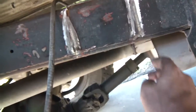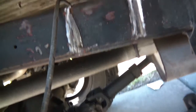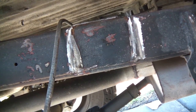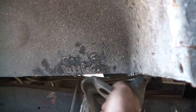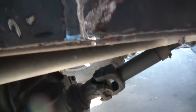Hopefully I didn't cut too much into the frame there. I put a weld bead down where it's a weak spot, it's not all the way through. I'm gonna grind the rest of the metal flush and might throw a bead over it. The frame rail isn't very thick there anyway. Once I got the sides cut, I was hitting it back and forth and broke the top weld just by whacking it up and down. Those are the two notches — they're in a little bit deep, so I might put a couple beads over those to make sure there's metal in there.